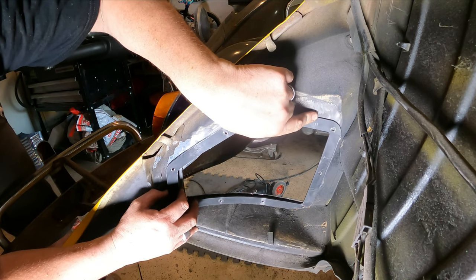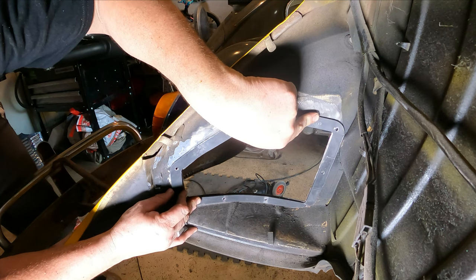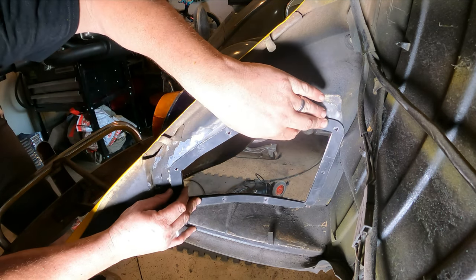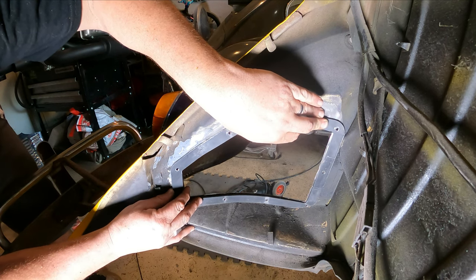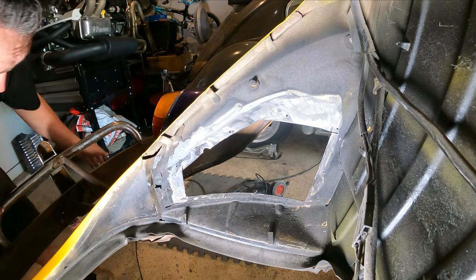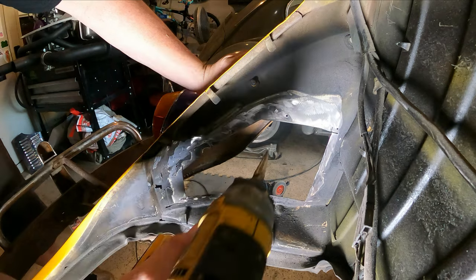So we can see - if we line up the holes - that's going to be a pretty nice hole. I might have a little more trimming to do, but you definitely want to get rid of all these sharp edges so that you don't slice your hands open while you're trying to work. So we're probably going to take that down a little bit. Now we can blow out the holes here for the screws that we put in with a unibit like this, and that way we can make these holes nice and big so that the tapped holes in that frame are easy to access.